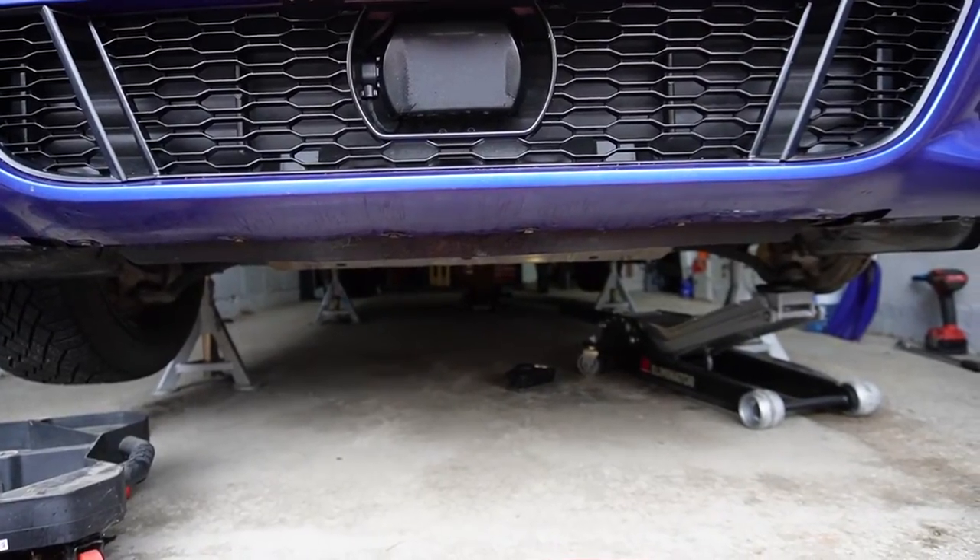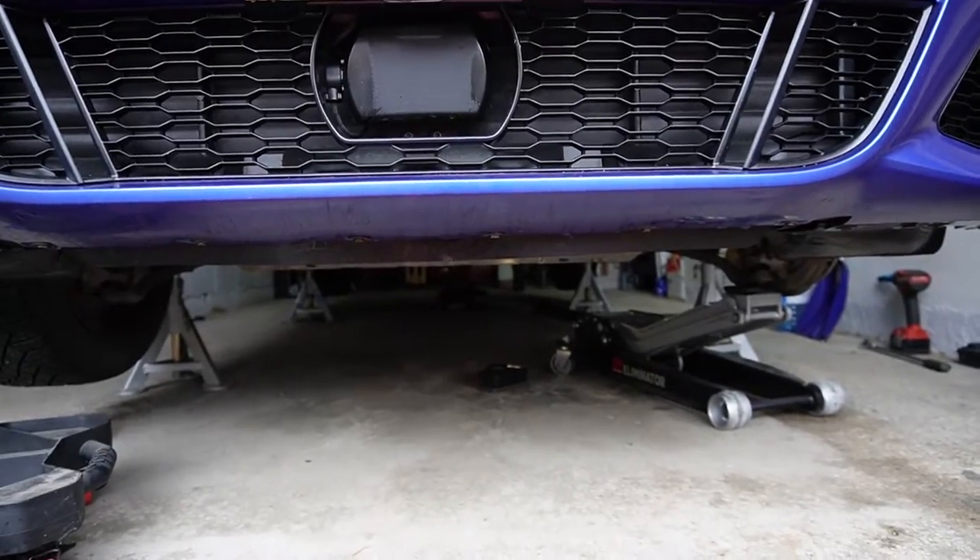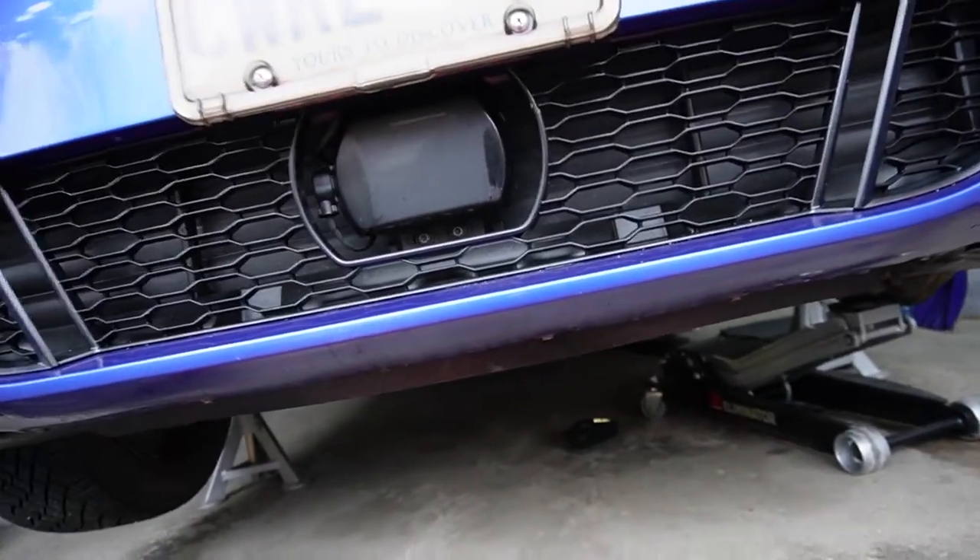The red circle you see is your fill plug for the front diff, right beside the axle. Now let's talk about the drain plug — we do have a drain plug for the front diff, fortunately, so we don't have to siphon out the old fluid from the fill hole.